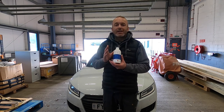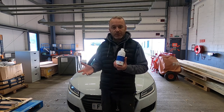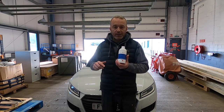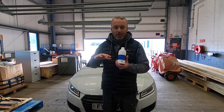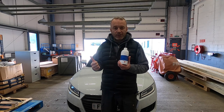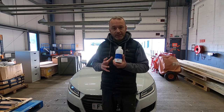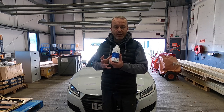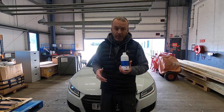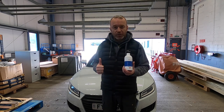In terms of where I see the need for this - if you're going to a car show, or if you've just detailed someone's car and put it through the full wash sequence, we all know when you look at your alloy wheels and your discs, they've got that orange haze of corrosion, that flash corrosion. Now, A, that looks unsightly, especially if you're at a show. But also when you drive away, the brake pads are going to press against the disc and that fine powder of corrosion is basically going to detach and fall into the inside of the wheel, which isn't good.